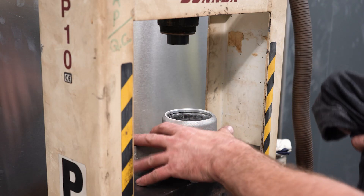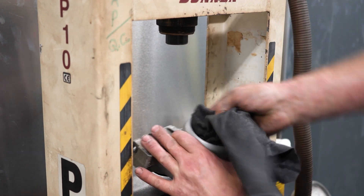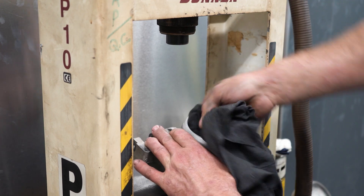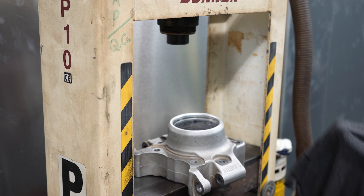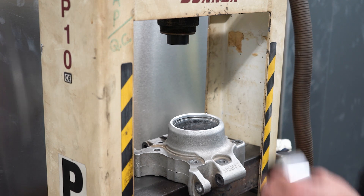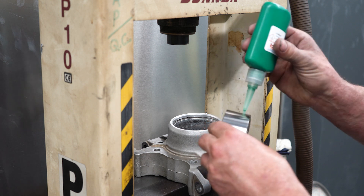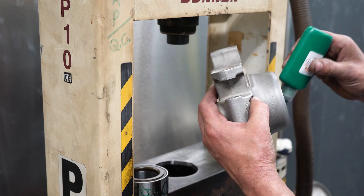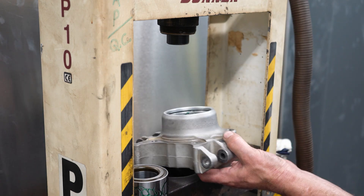In preparation for pressing in our new bearing, we're going to use a brake parts cleaner or edge degreaser to remove all the last little bit of grease and oil. Then I'm also going to wipe down the brand new bearing. We're going to use green retaining compound and apply it inside the hub as well — this is also going to act as a lubricant for pressing.